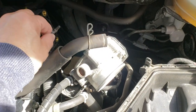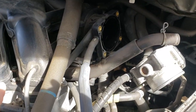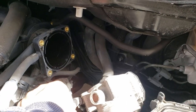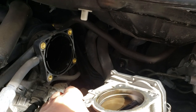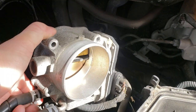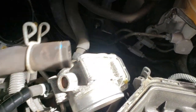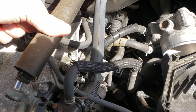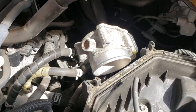When doing this spark plug change, you have to buy a new throttle plate gasket and new plenum gaskets - pretty cheap. I went with Fel-Pro, a good brand. It's also a good time to clean your throttle plate before putting it back. You can see all the oil marks from the PCV and everything in there.